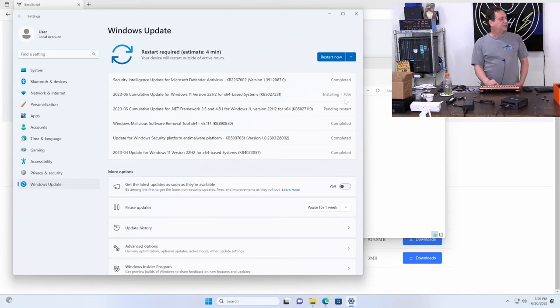John Paul Bacon wants to know, would creating an ISO of the RAID boot drive be possible? Yeah, I'm not quite sure what you'd do with it, but you have to understand that in order to recover the RAID, you have to be able to see the RAID. So if you have an ISO image or any type of full image backup of the machine, and you need to restore that image, whatever you're booting from to load the restore software needs to be able to see the RAID array. So the driver has to be put into the boot media. I'm not worried about what's on the image. I'm worried about the boot media being able to see the RAID array. That's why I say this complicates things, and it can make something very simple become very complicated, and certainly not for everybody.